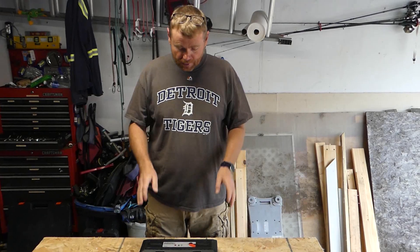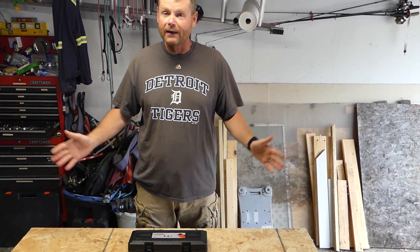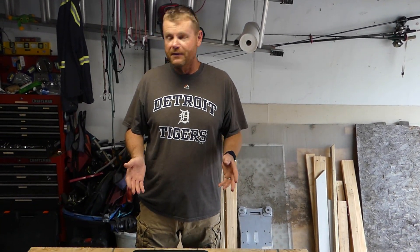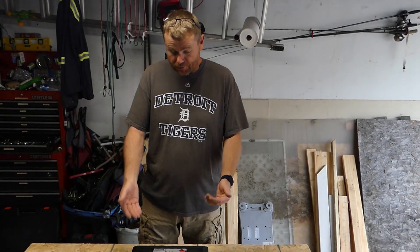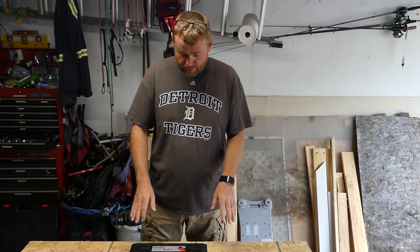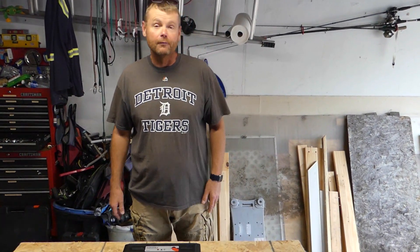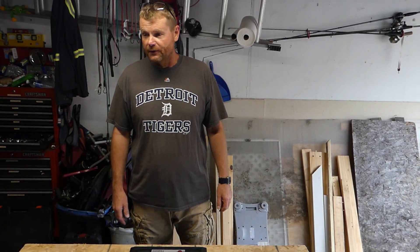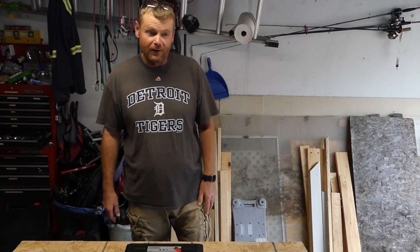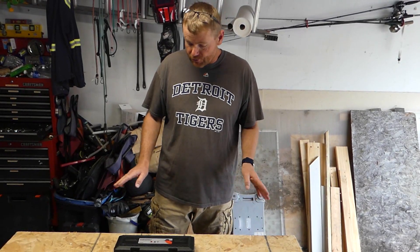This is from the brand name Sezum. If you haven't heard of them, go ahead and give them a look. They have a full line of automotive tools — not just necessarily automotive. Everything you can think of that you would need a torque wrench for, they have a wrench for it. Anywhere from quarter inch drive all the way to half inch drive. This one is a three eighths drive, which is going to satisfy most of my requirements working here in the shed doing automotive work. It's supposed to be very accurate within plus or minus two percent.